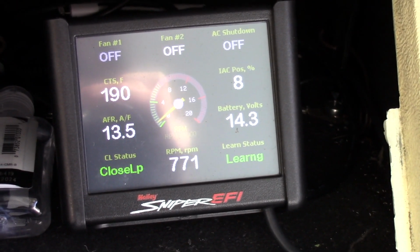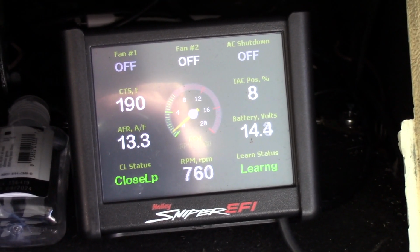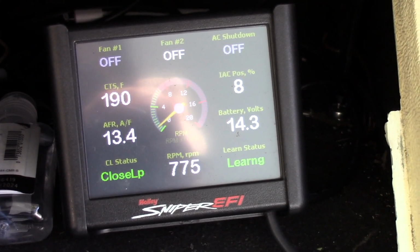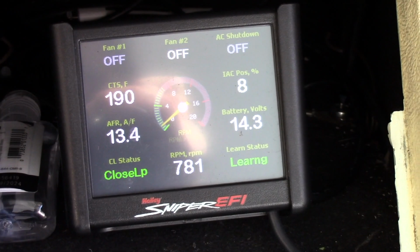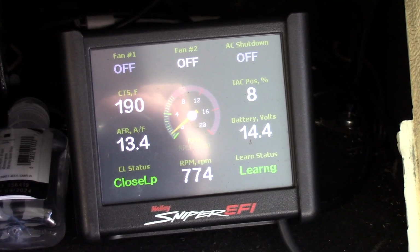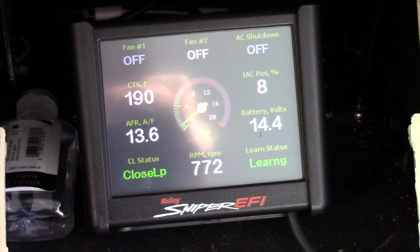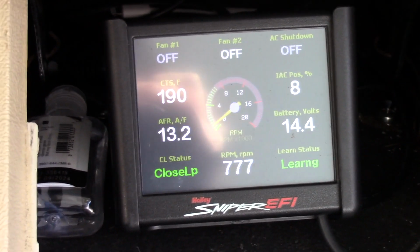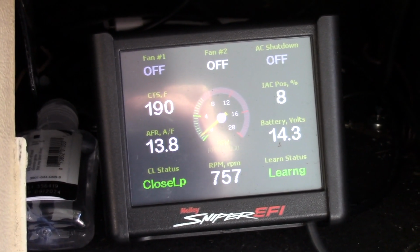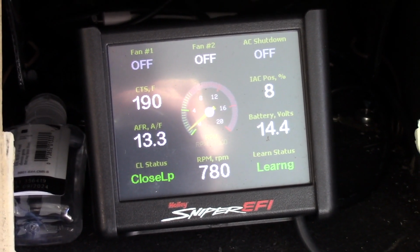As I was climbing the hill, it kept creeping up, and I'm thinking to myself, well, okay, it's still got a similar issue, but I didn't have a whole lot of speed going for airflow, so I kept driving to get off. I watched it, no problem. It hit 200, and that's when my electric fan kicks into high speed. You can watch my other video about the auto cool, but the auto cool only runs the fan up so fast before I have my fuel injection turn my fan on full speed. I was still climbing the hill at like 30, 40 miles an hour, 200 degrees.